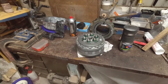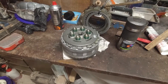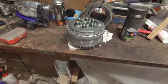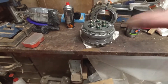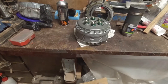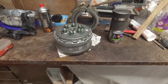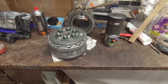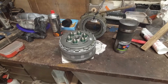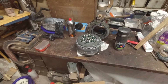The ball bearing that was missing — I've found one and I've got one coming for next week, so that's not a problem. It's the thrust washer that's going to cause me a bit of grief. The pack's all built, and that's how it's going back into the YXZ — as a full assembly. I just need to take the pressure plate off again, and I've also got to oil all the plates before it goes in. But for now I just want to keep everything together as a unit because it's going to sit on the bench for a few days. Bit of a nightmare.